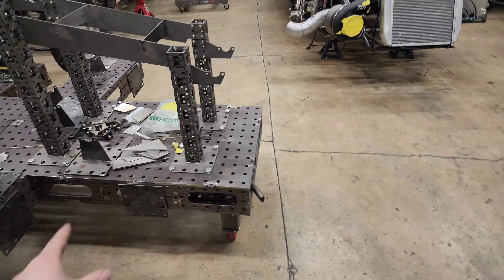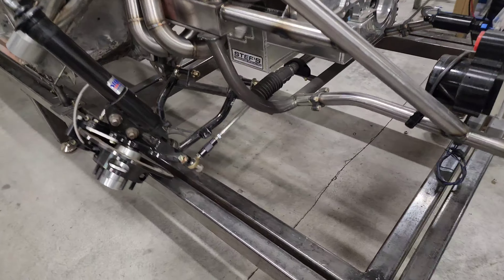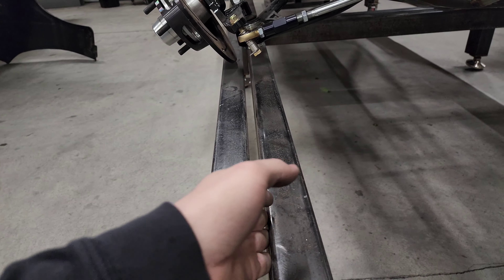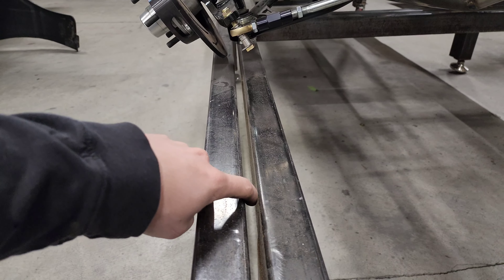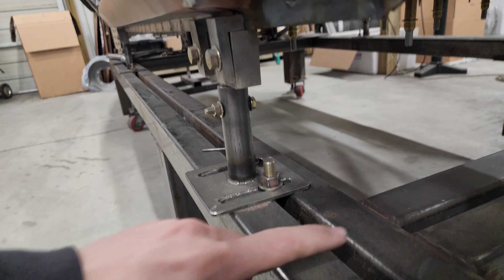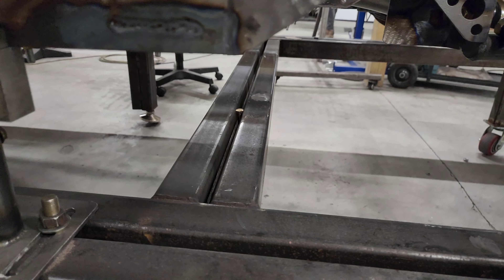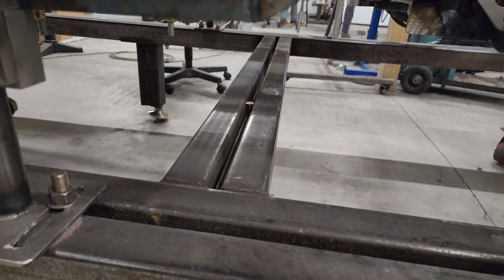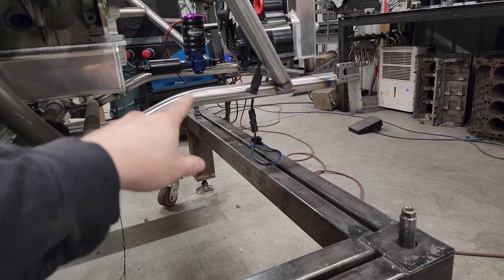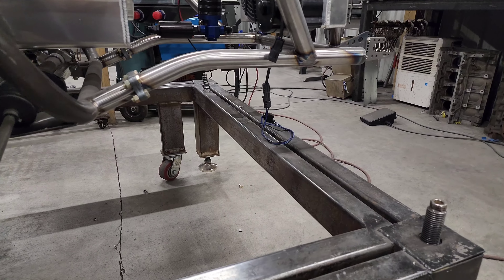That's the main jig — we upgraded to that one from this jig, but we still use this one after we get the main part of the chassis built. All this is is 2x3 steel, doubled up, with about a 9/16" gap so you can fit a half-inch bolt through easily. They have essentially another version of those clamps — bolted on and slideable for different cars. Cross members are in different areas: the one up here ties the front together, and we can use it for a tube front, but usually we end up using stands because it's easier.